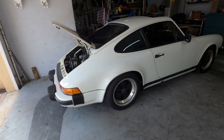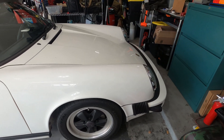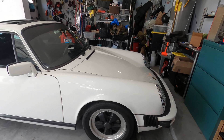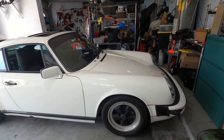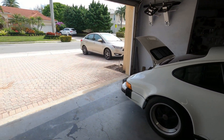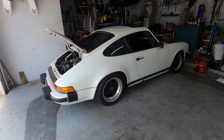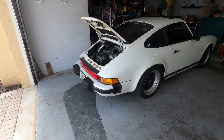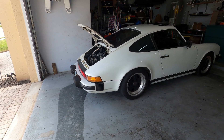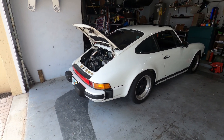You know, big block engine with iron heads and things like that as they came from the factory. If you had a big block with the engine in the front, you'd have your heads up in this area here. Those heads are damn heavy. So they avoided that in these Porsches. These have an aluminum case — they used to have magnesium cases which were much lighter, but when they developed the 930 Turbo they strengthened the case with aluminum. A Carrera 3.2's casting numbers start with 930, so they share the case with the turbo — naturally aspirated 930 Turbo engine in many regards.